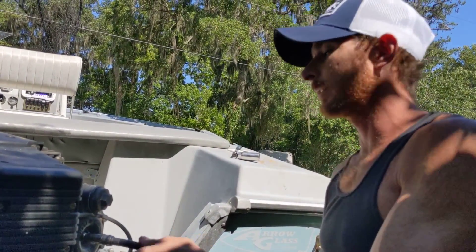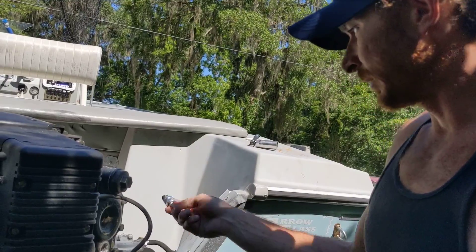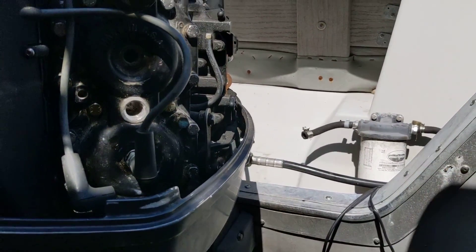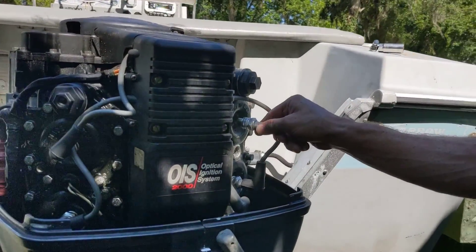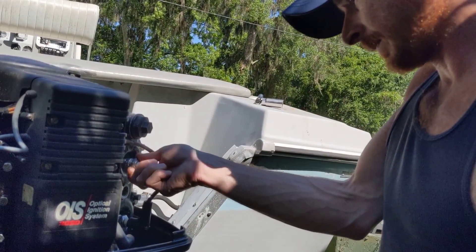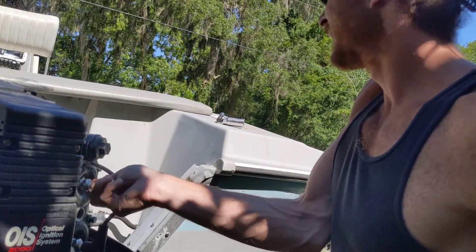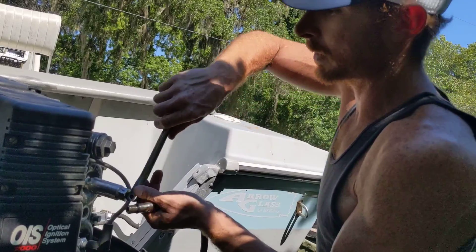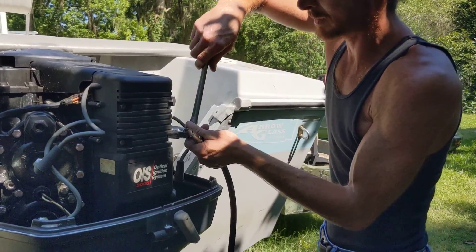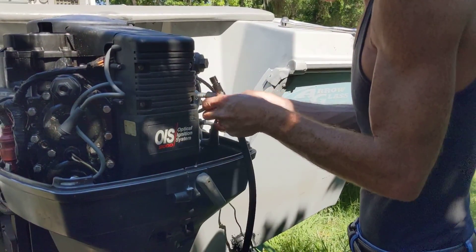I checked the primer bulb the other day. I got the heads done, went to prime it up, and the ball didn't get hard. So I disconnected the fuel lines and had the primer bulb on the inlet side, tried pumping the ball, and it was sucking air back in. That leads me to believe the check valve in the primer bulb was bad. It should have been the first thing I checked, but the primer bulb was basically new. Especially when you see water coming out of your head, the first thing you assume is a bad head gasket.